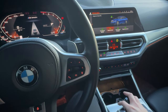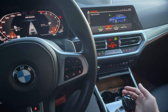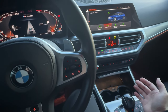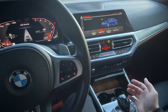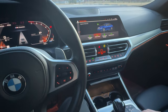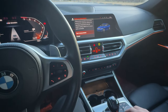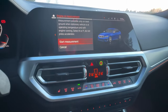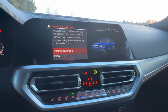With all that being said, if your car cannot measure oil through the digital dipstick, it doesn't necessarily mean your oil pump is going bad, but it's your first sign to be mindful of your oil level, any potential overheating issue, and any abnormal oil pressure. I had an intermittent issue measuring oil but had not experienced any abnormal oil pressure prior to oil pump replacement. I had a local shop replace my oil pump with the updated version as preventive maintenance, as I plan on keeping the car for a long, long time.